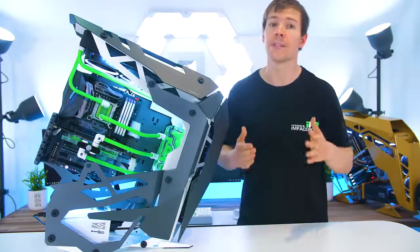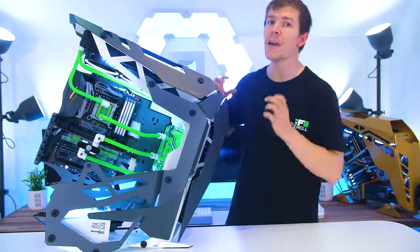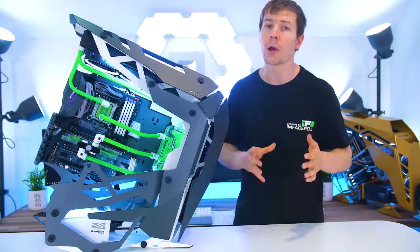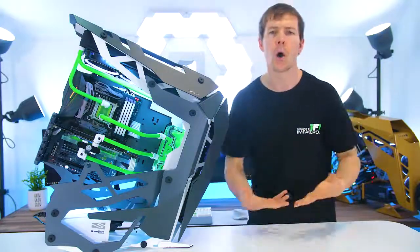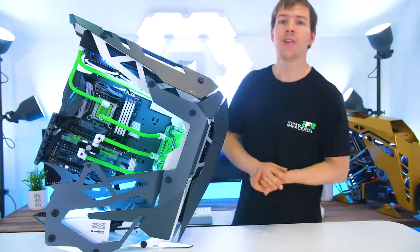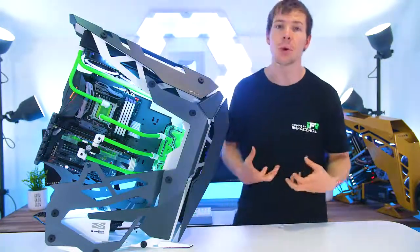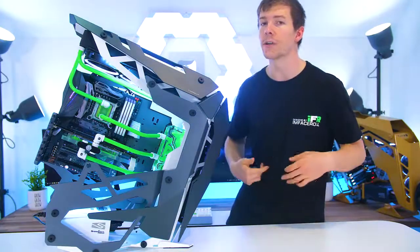And the best part about these as well is they are standard connectors, so you can plug any fan or any RGB header into these controllers and they will work. Now, this does have support for Asus Aura and MSI and everything like that. However, it also does have control on the fan hub itself, so you don't actually have to bring the cables and put your USB headers into the motherboard, so you're keeping it really nice and clean. We actually set it white from the controller itself.